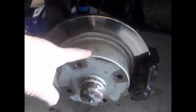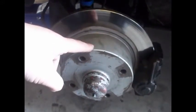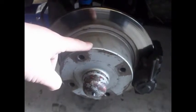The only way you can make it work is if you customize it — cut it and then weld the back part of the arm. But that's a different topic. If you're upgrading, you might think about just also getting the disc-compatible drop spindles. It'll save you a lot of headaches later on if you want to drop the vehicle.